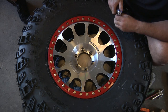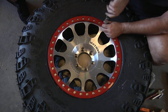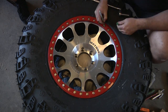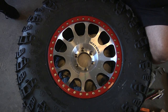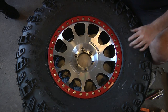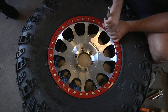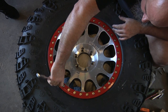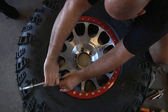Now we've got them all in. We can go ahead and take out our four long ones and put the right size ones in. Be sure to mark these four long ones again so you know where you're starting and stopping when you start torquing the wheel. Now we're just going to go and start walking these down — you'll be able to see it come down. If you're uncomfortable with it, you can grab the torque wrench and torque them each time. We've done enough of these that we just kind of walk them down a little bit, give them a couple cranks. You'll see that as you start snugging them up, the ones behind it will get loose.